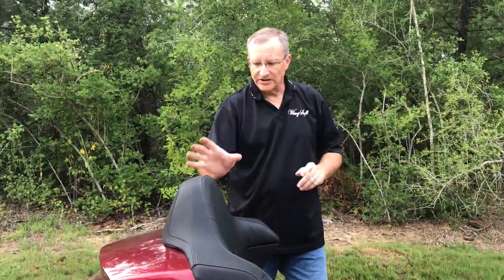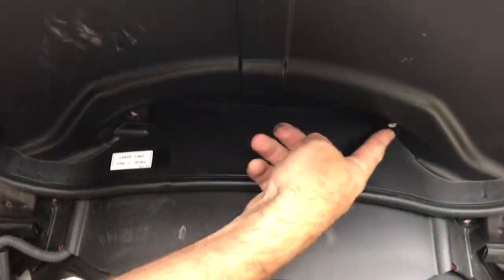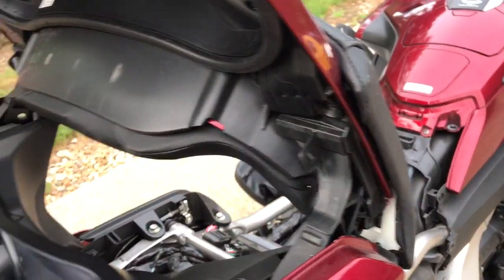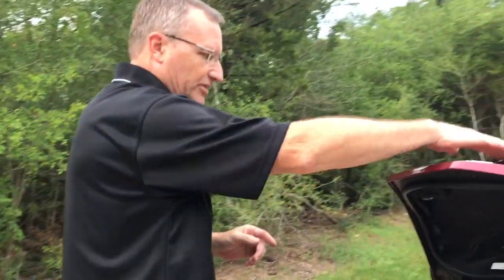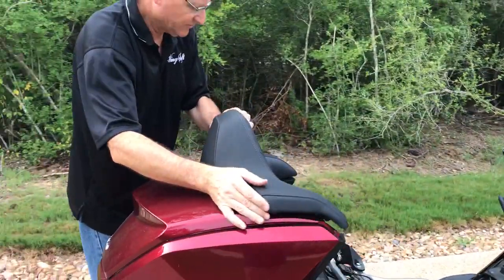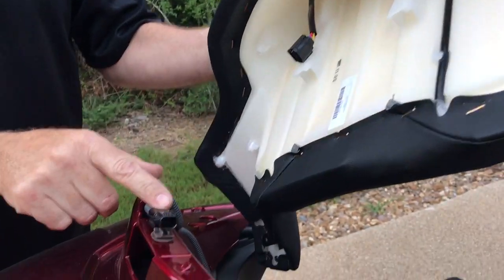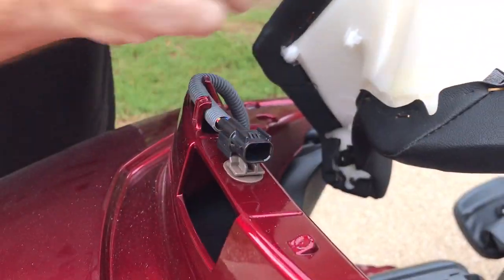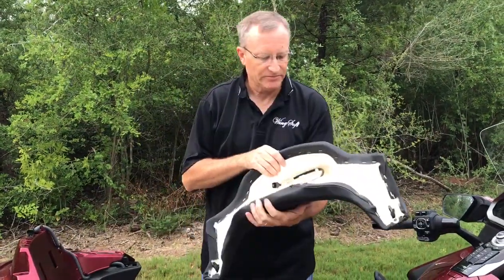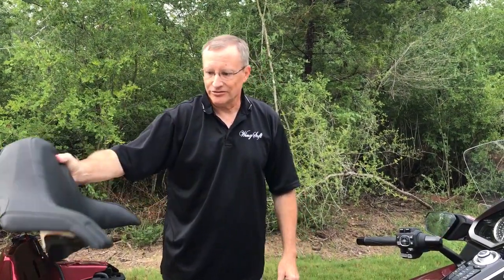To take the passenger backrest off, you have to open up your trunk and take out a bunch of screws. You have a screw here, here, here, here in the front, and then the same on the other side. The two screws in the very front corner are a little bit shorter, so just keep those separate. Once you have all those screws out, the backrest just lifts straight up — give it a little lip on the front, pull that up. On yours you'll have the electrical connector attached: just push down on the little key and pull it out. To put it back together, just reverse the process — hook your electrical up and screw it down.